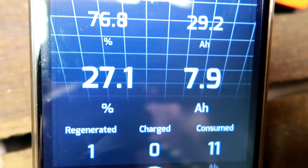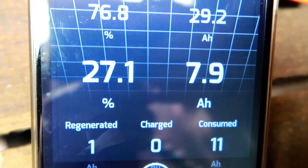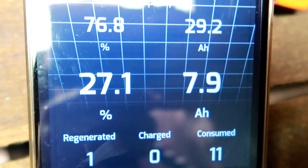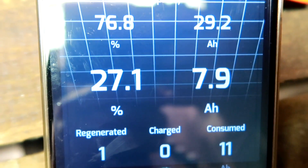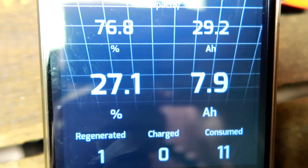So 6 amp after six hours — just putting this information in here as well, you can never have enough data. We are leaving the car with 27.1% state of charge this evening, and I'm setting up the EVSE to 10 amps now to see what the battery temperature is tomorrow morning.